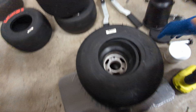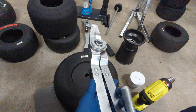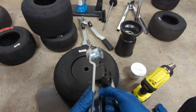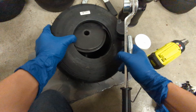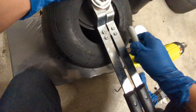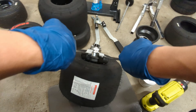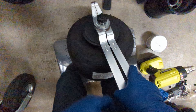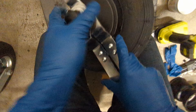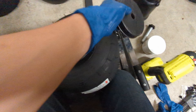At this point you've got one side mounted and we need to use the tire tongs again to mount the back side. Stick that disc back in. This time flip the tongs over so the grips are facing the wheel, then use them to grab the edge of the wheel and have the pin ready in your other hand to press it through once it's lined up. At this point you're locked and you just need to swing those tongs out again to finish the mounting. Make sure the tire basically looks normal on the wheel — if you've got any big gaps you won't be able to inflate it later without air escaping out.